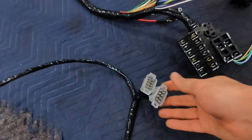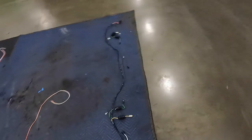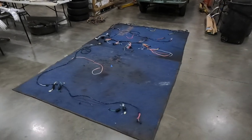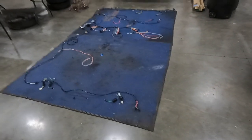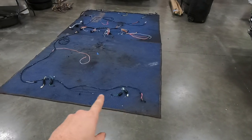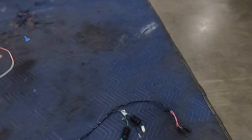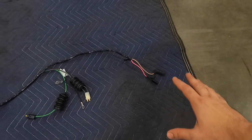So let me show you guys what I have laid out here. The way the car is oriented, all of the wiring follows the same orientation. This is the passenger rear corner of the car — this is the tail lights. It runs along the back of the car and goes forward on the driver's side. Starting with the gas tank: a little tidbit of information, this is a three-wire sending unit, which I heard was only used on C2 Corvettes — kind of an experimental thing.